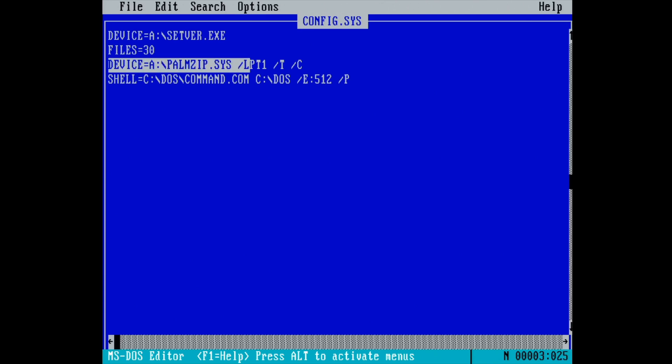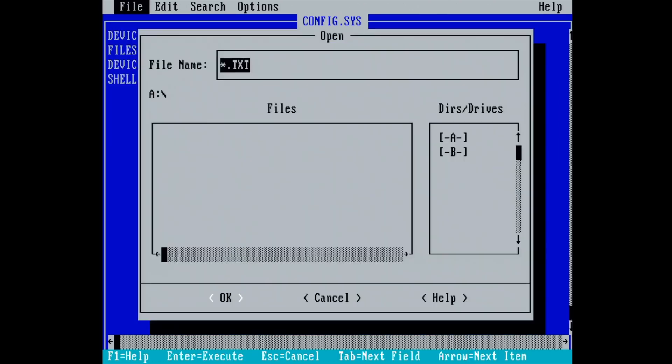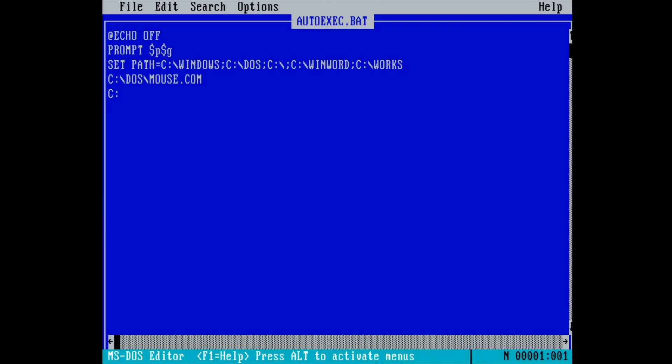There's more information on how to get this driver in the description if you're interested. To make it work, all I had to do was add the driver to my config.sys and autoexec.bat on a boot floppy, which has a very basic install of DOS 5 on it. Once the system loads the driver, it transfers control of the system to the full DOS install on the ZIP disk. Access speeds aren't the greatest on this system, but it's allowed me to experiment and has honestly been a great option for an infrequently used machine. I've been able to run games, Windows 3.0, and many DOS productivity tools off of the ZIP disk.